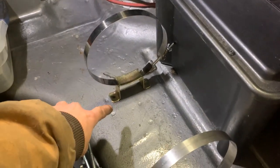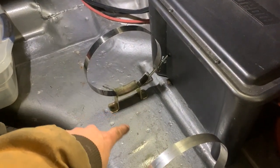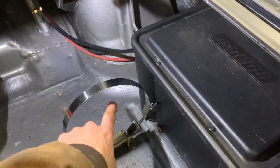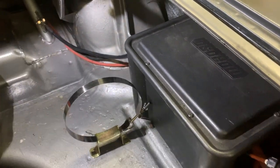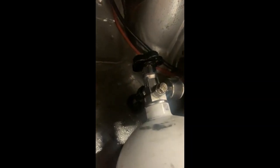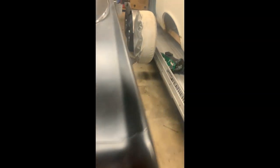Here's another visual — you can see the tall bracket goes in the front, short bracket in the back. Again you can see the spot welds and how I'm straddling the rail. The bottle is now installed. Right there is where I've got the grommet going through the body, and the line basically just follows along the fuel line to the front.